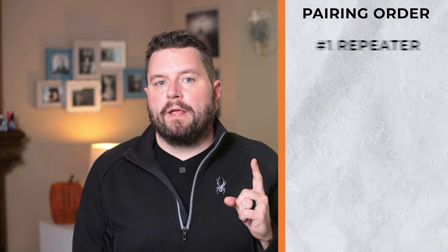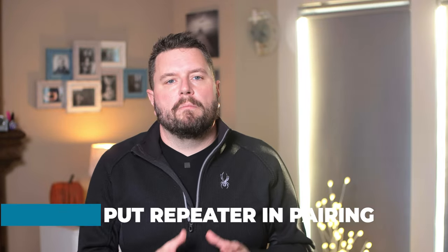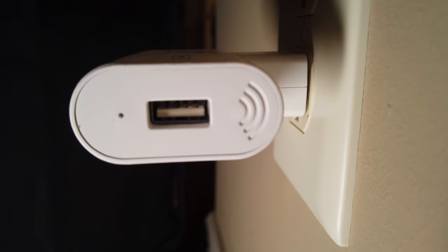Let's move on to pairing. If you're going to use the shade without a hub, just put the battery in your remote, stick them on the wall and you're done. But if you're pairing with a hub we have a few more steps. This is a tip I picked up from the Zigbee2MQTT forums: you need to pair your items in this particular order — number one the repeater, number two the shade, number three the remote. To pair the repeater, put your hub into pairing mode and then press and hold the little button with a paperclip or SIM remover. Make sure you feel the little click of the button — it's easy to miss. Hold this down for about five seconds until you see the light start to pulse. Once you've paired it and confirmed it in your hub or app, let's move to the shade.